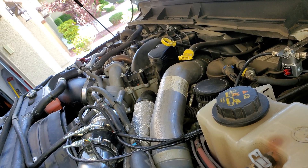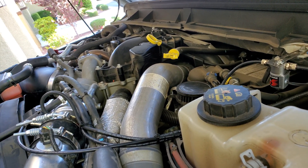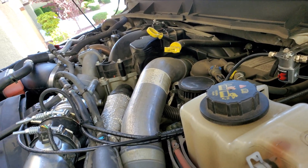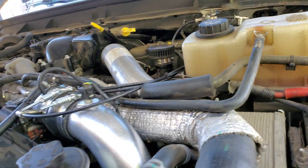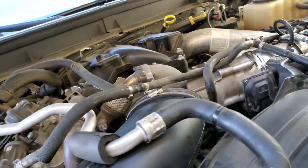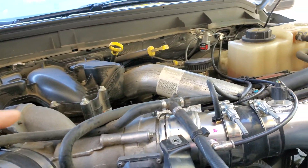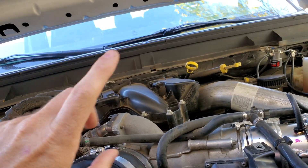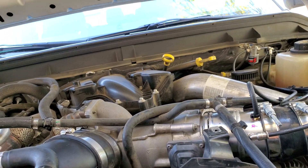This is not supposed to affect the DPF or the regen process whatsoever, but I'm leaving it off just to make sure everything goes smooth the first time. Highly recommend putting methanol on your diesel — diesels really love it. It typically creates pressure after top dead center, so it's actually safer than trying to pump a bunch of diesel and boost into the engine. Plus, if you still have EGR installed, spraying methanol is cleaning all that dirty exhaust coming back into the intake.